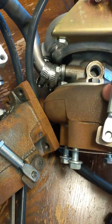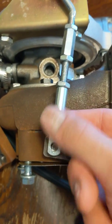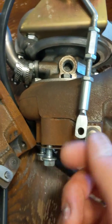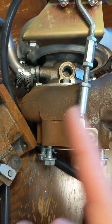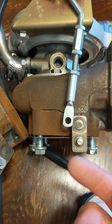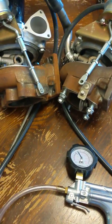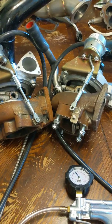If you want to adjust them, you just undo this lock nut right here, and once it's disconnected from the wastegate you can either loosen it or tighten it. You would loosen it to lower the pressure and tighten it to raise the pressure. The rule of thumb is two half turns, or one full turn, will change it by one psi. So hopefully that helps — something I was just playing around with and wanted to share. Thanks guys.